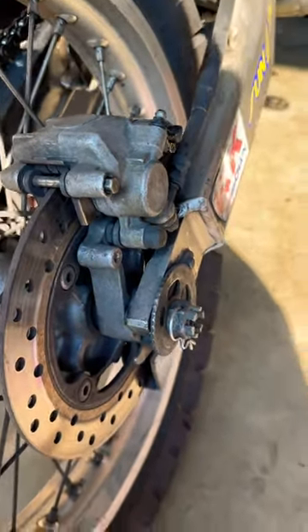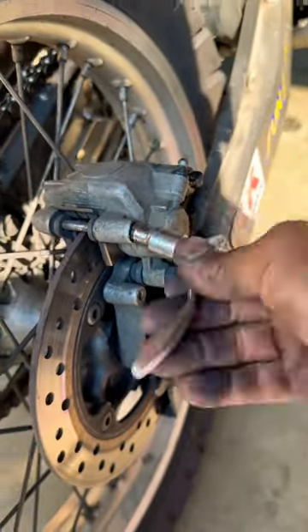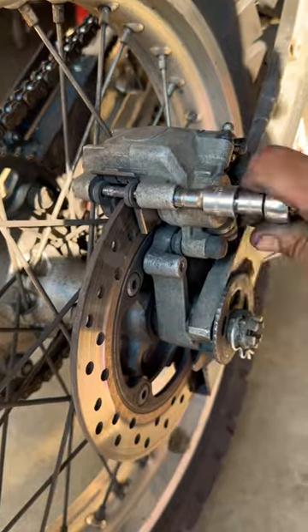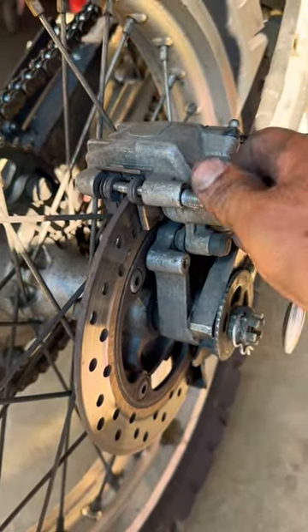After I get done doing that, I'll take my little eight right here and this little mini wrench, crack this and spin this out. When you remove this pin, you'll be able to drop your pads out and they'll already be prepped up to install your new ones.